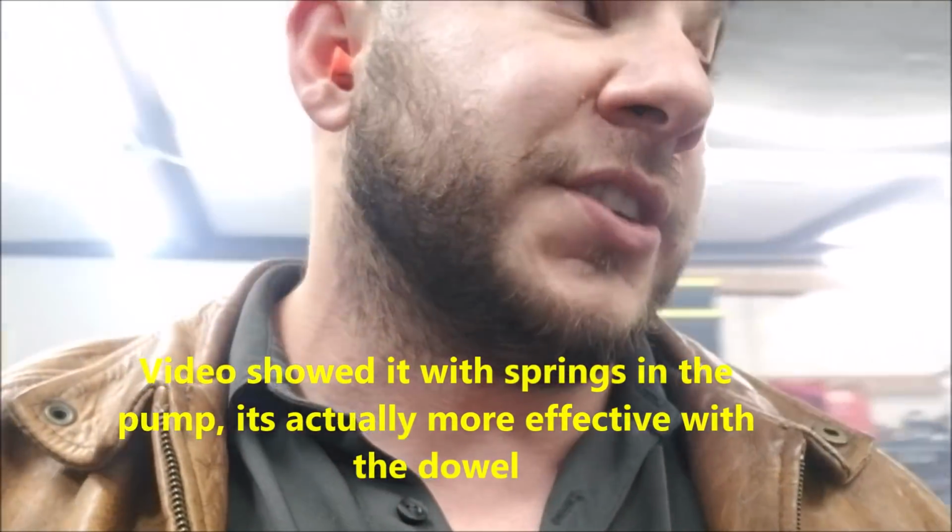Now I don't really know how hard the pump is working, but I'm seeing a good 128 psi at 160 degrees Fahrenheit oil temps. When it gets up to about 210, 220, the oil pressure comes down to about 122, 123, 125, somewhere in there, depending on the RPM. So running great, running solid.